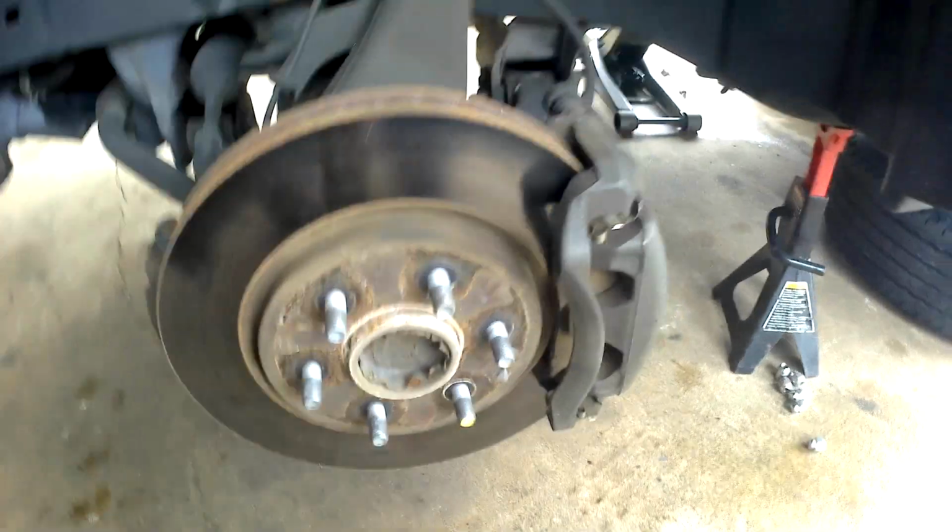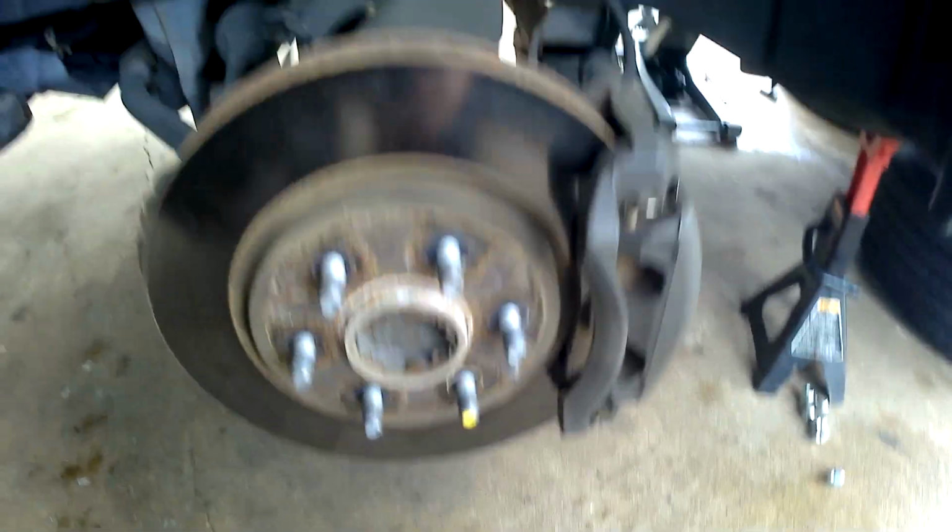So here we go. Look at the suspension. We've got kind of a small disc, but it looks pretty good. Got coilovers, rack and pinion suspension there. Looks like it needs some tie rod ends. You can see that right there, kind of cracked. I could really use a light, to tell you the truth. The others look pretty good, actually. The lowers look like they're okay. Not sure about this lower ball joint here. The rubber is kind of brittle, so probably about time.